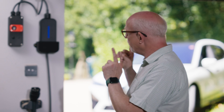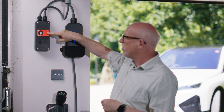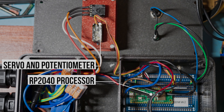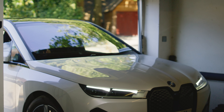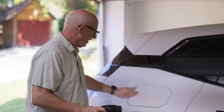Four kilowatts at 10 hours is enough for 52 percent charge, which is about 125 miles. At 12 hours that's 62 percent, which is 150 miles — and by that I mean 150 miles in the cold with a 25 mile margin. Here it is in its full glory. Here's the servo, which is fully electrically isolated from any of the other components, so there are no internal modifications to the BMW unit. That means we're good on safety and good on warranty.